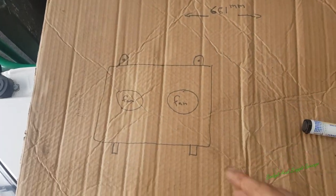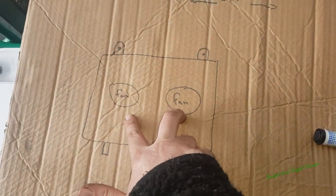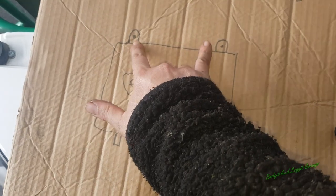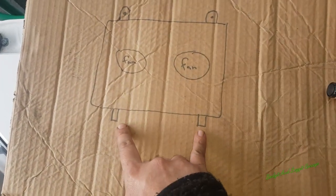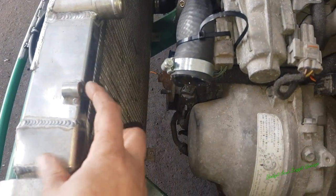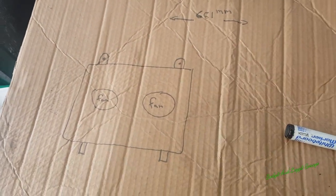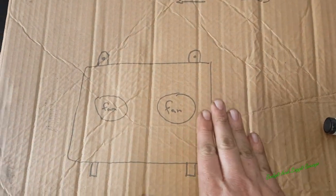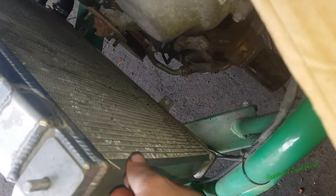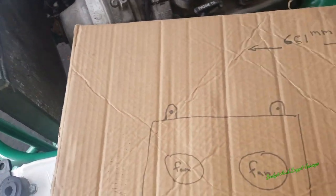Here's what I'm thinking: we're going to have a box with lips on each end, two 10-inch fans in the middle, two tabs at the top with holes in, and two locating studs at the bottom. The locating studs go into the actual holes at the bottom of the rad, and the two little ears at the top let us bolt the shroud on top with two M8 bolts or something like that. I'm also thinking of doing a return lip - an L-shape - so I can drill little holes into the flange and use cable ties to stop it flapping around, two on each side.